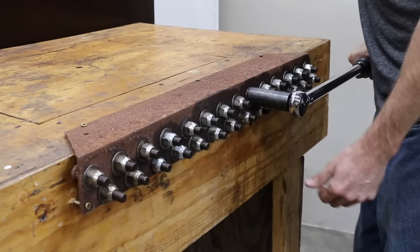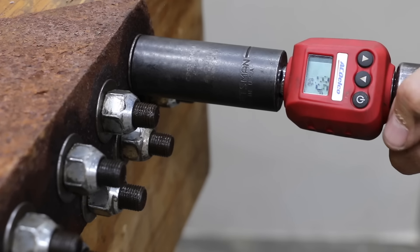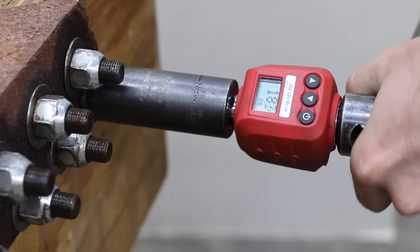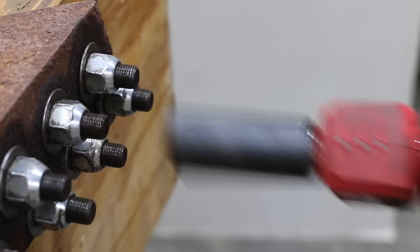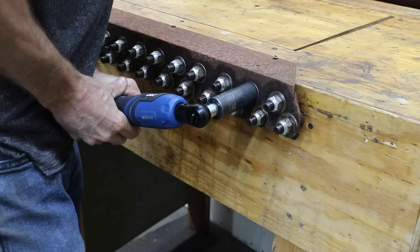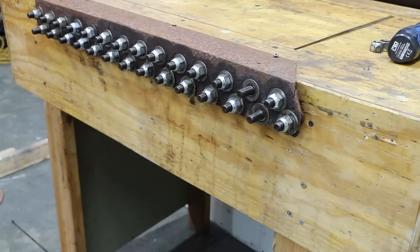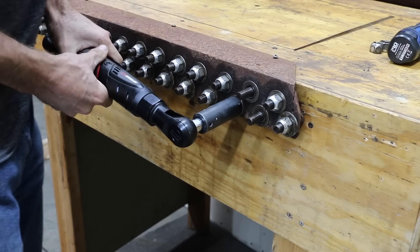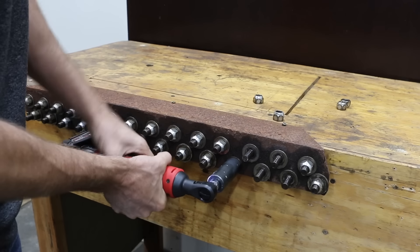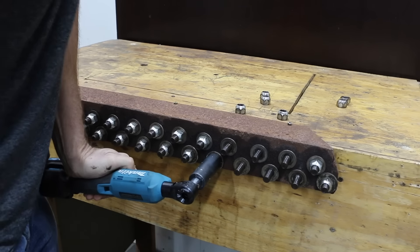In the manual use test, all lug nuts were first tightened to 90 foot-pounds, then the breakaway torque was measured. It took 77.6 foot-pounds to break loose the first lug nut and 77.4 for the second. The ProStormer did just fine on both lug nuts with no apparent damage. With its longer handle, the Earthquake offered more leverage and had no problem removing both. The Milwaukee, with a much shorter handle and less leverage, took more effort but held up just fine. The Makita's longer handle provided good leverage and made easy work of both lug nuts.